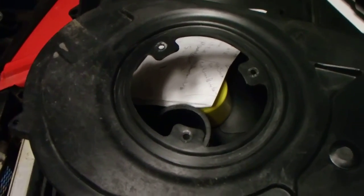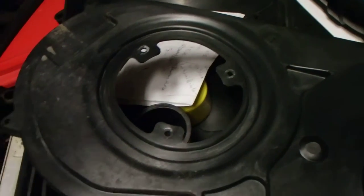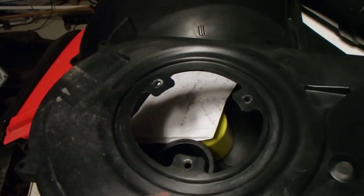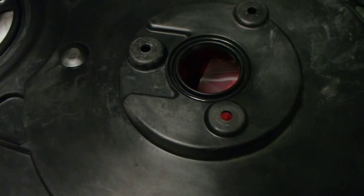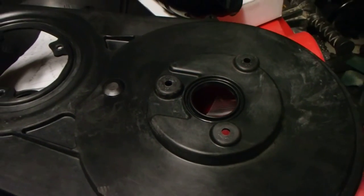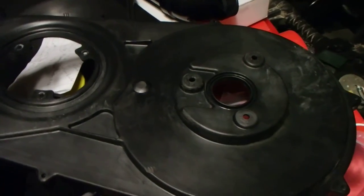Removing this from the engine side is not bad — on mine it did not stick to the engine at all. The blue RTV actually only sits in the cover itself, probably because the engine side wall is very thin and will press against that blue RTV. Everybody's doing that, Polaris is doing that, I'm confident that's the right way to seal it up. For this bearing side I've used a homemade O-ring. I haven't measured it precisely, but I'm sure if you measured it you could order a pre-made O-ring — I'd suggest the thinner the better.